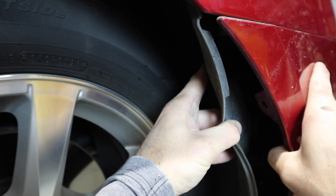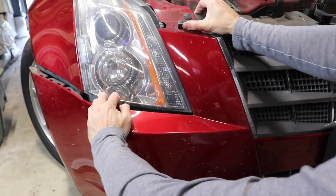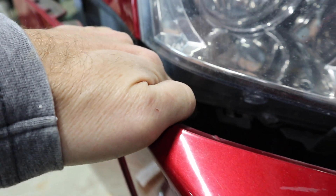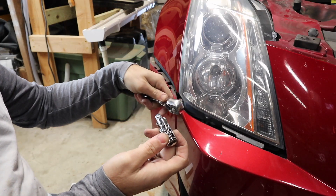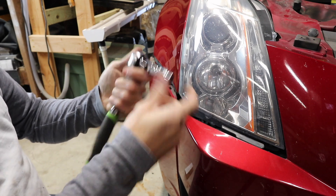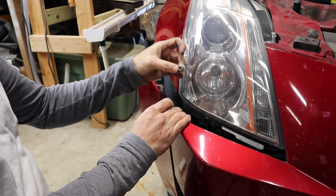And there it is. Now we can pull our bumper away from here and that will also give us the ability to pull our bumper away from the front. When you pull this forward it will expose a nut all the way down by my finger, and that holds on the bottom of the headlight housing. If you don't have a power ratchet that can get down in there, you're probably going to need a swivel like this for your 10 millimeter — it's just going to make it a lot easier. Be careful when you're taking it off because you don't want to lose it down into that plastic shroud below.